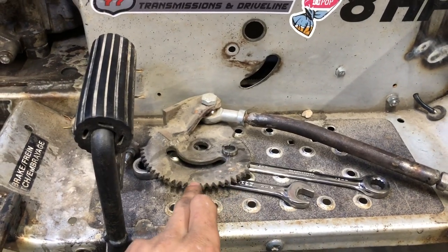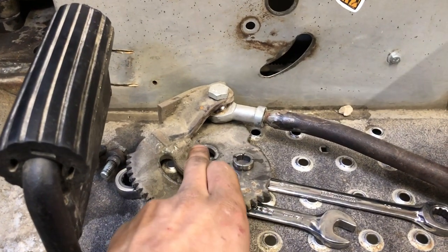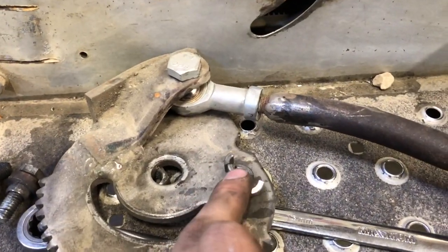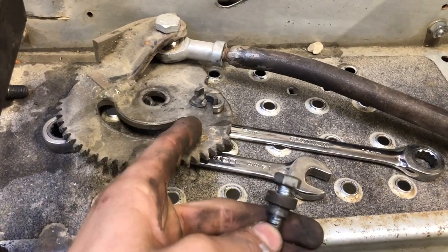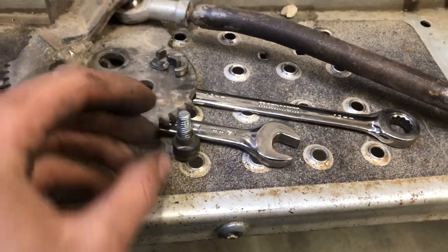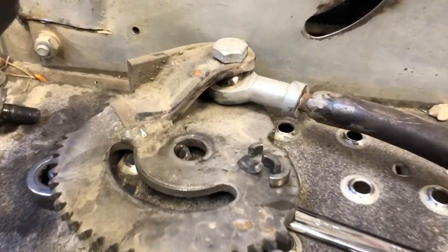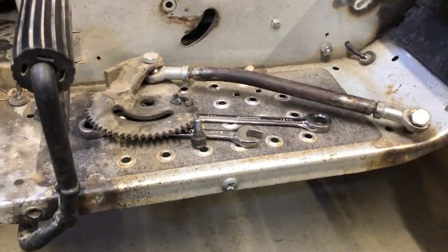Now this was the original plate and I added on obviously this part. Now, original bushing inside this hole so that you can clamp down this plate but not actually keep the plate from actually moving. So this is just a bushing. Well, it exploded on me into four pieces as soon as I pulled it out. And this little bushing that stays in the inside of this run to keep the plate from getting any more play has that little run in it. So we're gonna fix that now. And hopefully that should fix a lot of the play along with the rubber in the tie rod. So that's decent. Always nice when you have a problem, you can find a solution, or find at least your problem and then come up with a solution.